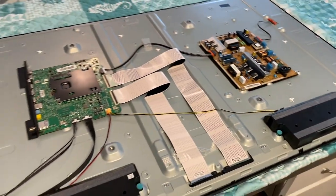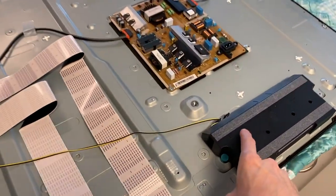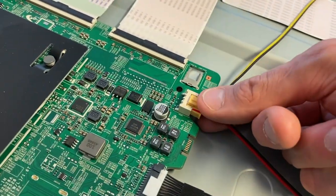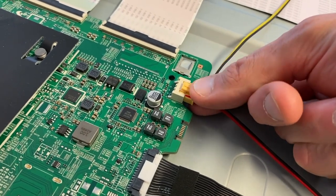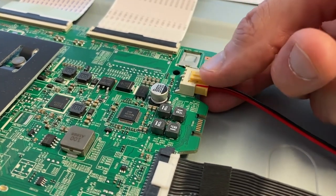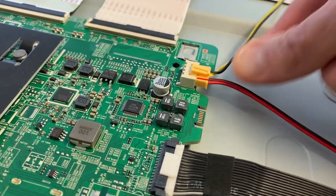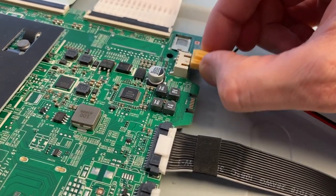If you're standing in front of the TV with it mounted on the wall or on an entertainment center, that will be your left speaker; this will be your right speaker. From here, what I want to do is carefully disconnect this yellow connection point to the main board. The way to do this is right at the edge here — push down, and as you do that you will raise the upper portion out of its locking slot. Do not pull by the wiring; get a good grip of the plastic connection and carefully shift it rearward. Once it's out of that slot, you should just be able to wiggle it right out.